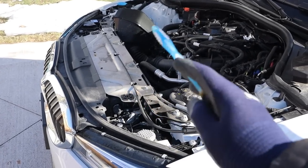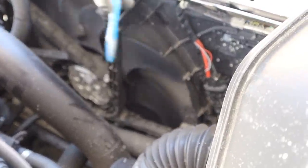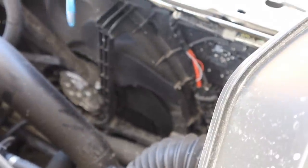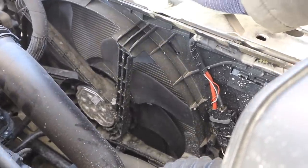You just remove this shield and most of it slides right up. From behind, the cooling fan setup is one giant plastic fan as opposed to a twin setup unit, motored in the middle. Behind that is the radiator, with a transmission cooler integrated at the bottom and the AC condenser.